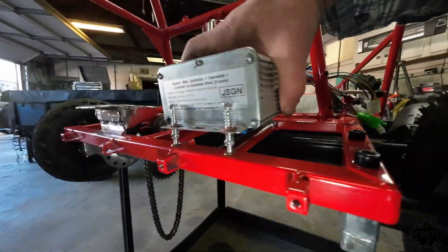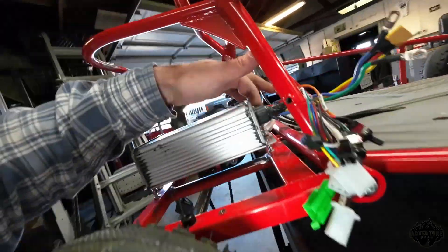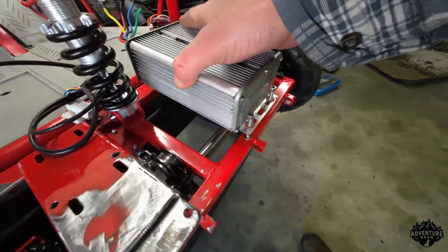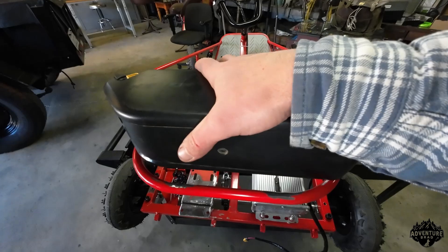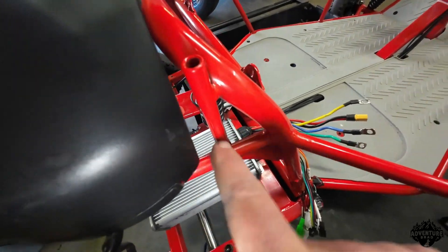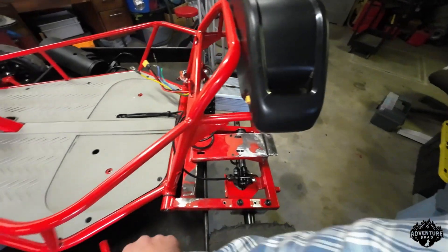So this is what I came up with for a mount. I might do some more dialing in of it, but for right now this is what we got. I did a single hole in the front so I could reach down between here and get this off. And I ended up cutting the battery here — the little back brace is off. I'm going to end up running the battery right here, strapped on temporarily, because I don't have a piece of metal to weld on that's long enough. I'm going to come up with a piece of angle or channel and weld on down across here.